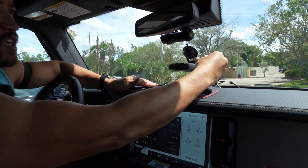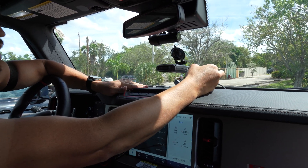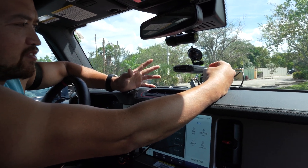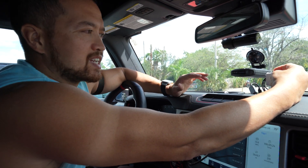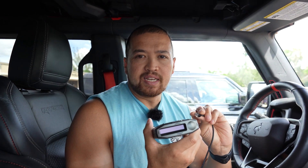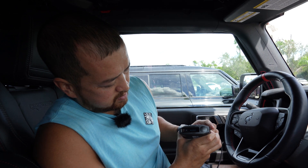Let's use a known QC/PD output adapter and see what happens with the version 1. This test will pretty much mimic what some of the newer Teslas have already built in. These USB-C ports look exactly the same on the face but they function differently. I've plugged in version 1 to a QC/PD AC adapter — we have an AC inverter in the back of this vehicle. It powers up and you get no low voltage warning because the adapter has automatically detected that it needs to output 12 volts.